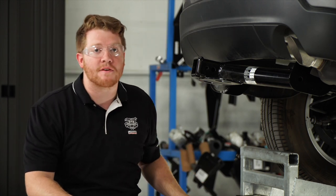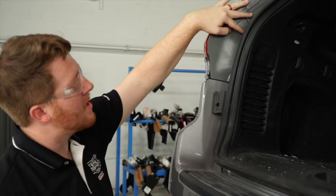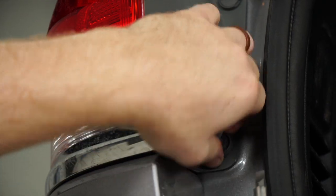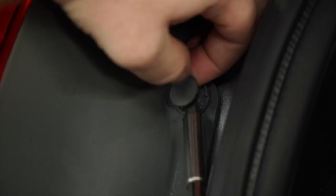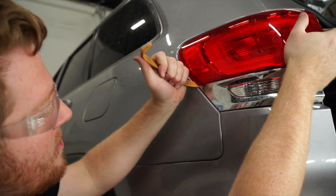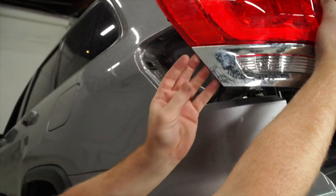Our wiring harness will be going through the tail lights of the vehicle, so we'll start up there. Our first step is to remove the driver side tail light. We'll do that by removing these two push pins using a flathead screwdriver. With the two push pins out, we'll remove the driver side tail light using a trim panel removal tool — slide it in and that gives us access to take it out.